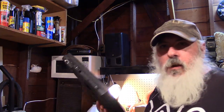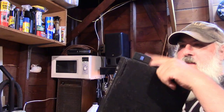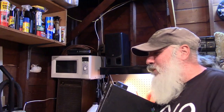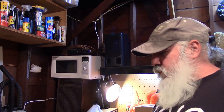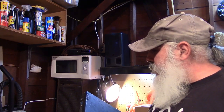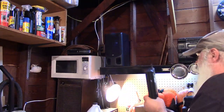So I said, all right, let me go ahead and see if it's the power adapter. So I brought this downstairs to the washroom, and I put it down, and I already had pulled the hard drive out, pulled the CD-ROM drive out, pulled the Linksys wireless card out, because this doesn't even have that kind, pulled all that crap out, and it still wouldn't power up. Now I remembered I got one of those multi-voltage, multi-laptop, universal type jobbers. So I got one of those out. Plugged it in. And thank God, it worked. So all we have is a dead AC adapter.